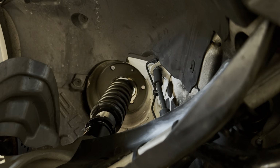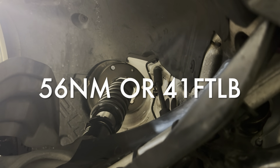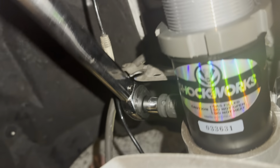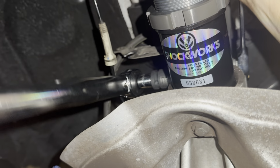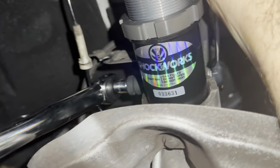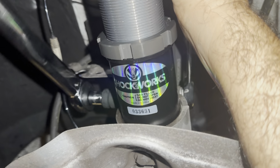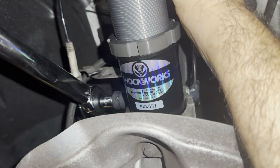Now, I'm going to put the torque specs on this bolt. This could be one of those bolts that BMW says is a one-time stretch bolt. I think it might be, but I'll put the torque specs on. I'm just reusing them. Okay, torquing down the pinch bolt. It's 56 newton meters, and it's tough to get in here. All right, come on, there we go. I do have a little adapter on this because this is my shorter torque wrench. There we go, 56 newton meters, clickety click.